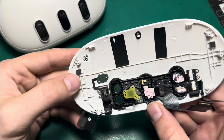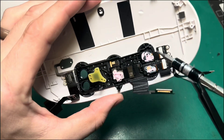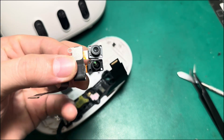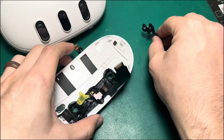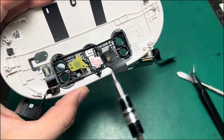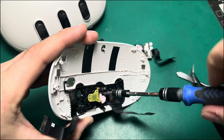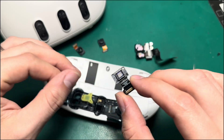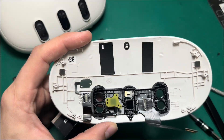What's interesting now is that those cameras are up — these ribbons just kind of go all over the place. We'll take these out with a heat gun in a bit. We'll go ahead and take out the cameras on the other side now. That whole assembly just comes up and those cameras are just in place on that ribbon. And that leaves us with our actual depth sensor. To the best that I can determine, it's actually an infrared line emitter — it just emits infrared light and calculates depth that way. If somebody knows more about that, please leave a comment. And now all we've got are these ribbons adhered on here, so I want to take a heat gun and remove those.